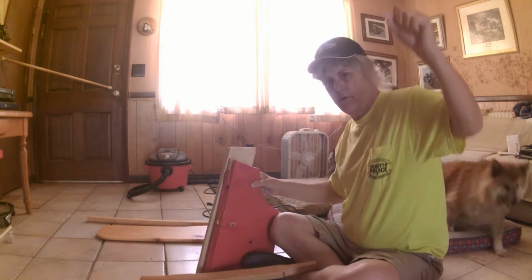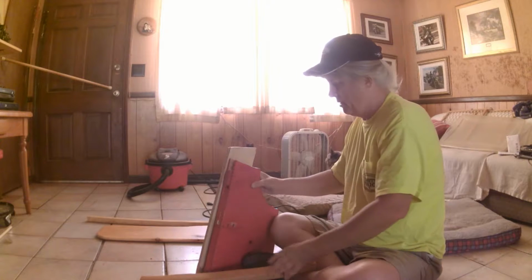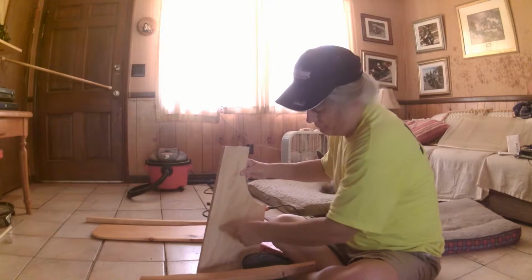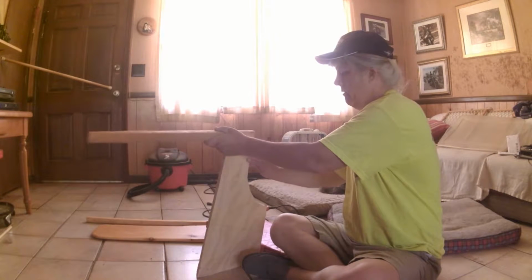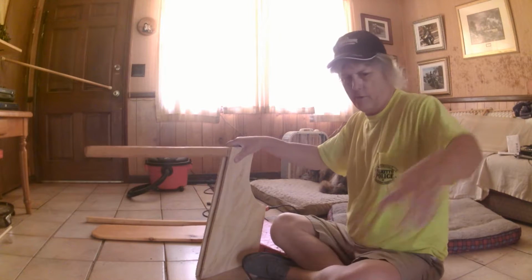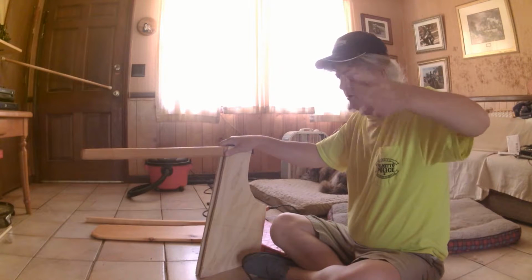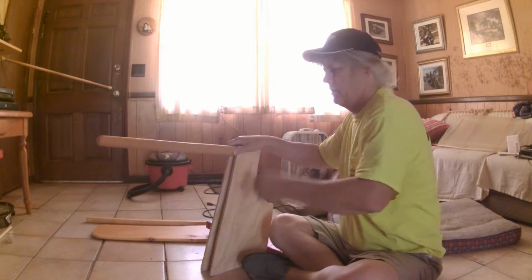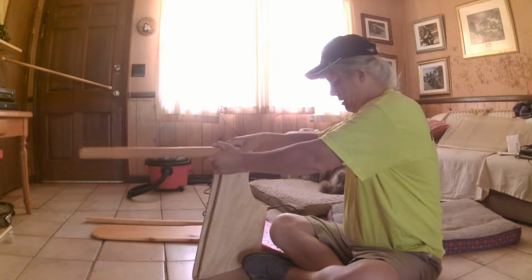Down in the boat, the way I do the steering, you have your arm up here on the rudder, which gets tiresome. So I wanted it parallel with the deck. So I measured from where the eye bolts are, which is where the attachments on the transom are, measured up and cut it off. And now when I put the tiller in there, it's more or less flat. Plus I've got a little bungee cord setup there that holds the tiller straight in case I need to go fiddle with the sail or something like that. So these dimensions are about right.